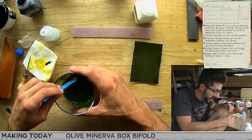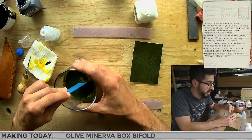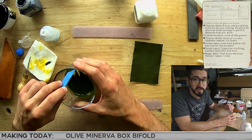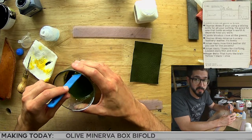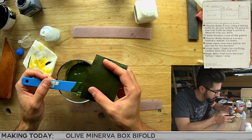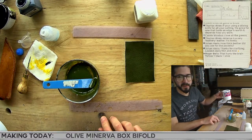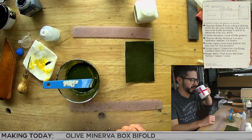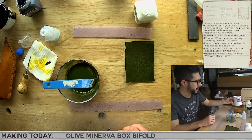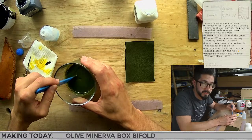So getting an exact color match, even with an exact mix, is impossible. And the mix will vary depending on the total amount you mix. Certain colors have to be mixed in a certain minimum amount to begin to get close, which is very frustrating. When you need to paint a single fender, and the mix formula tells you to mix half a gallon to paint one fender, it's very, very frustrating. Nowadays, with the supply situation being what it is, it's a mess.